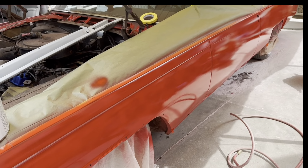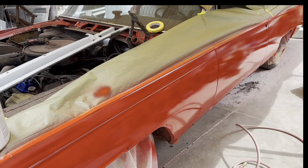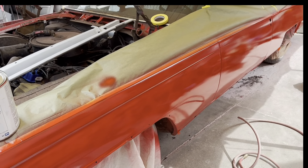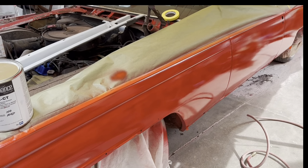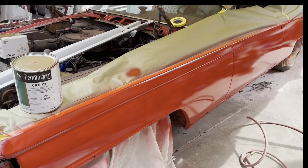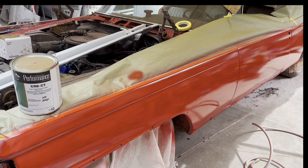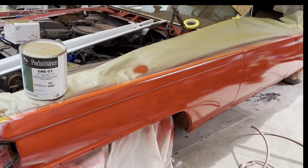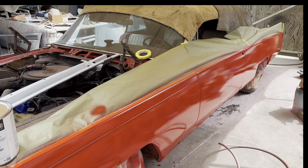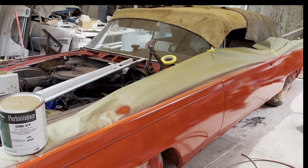Normally what I do is I'll paint a car with gray or white primer. And then I'll seal it with a color that's close to the car. I use House of Color tinted primer. They make red, blue, yellow, black, and white. And I use the red and the blue and the yellow a lot. The red will cover in one coat, and this is 3 coats. It still hasn't covered. So I was trying to cut that step out because the House of Color primer is now like $100 a quart, so it's pretty ridiculously expensive.